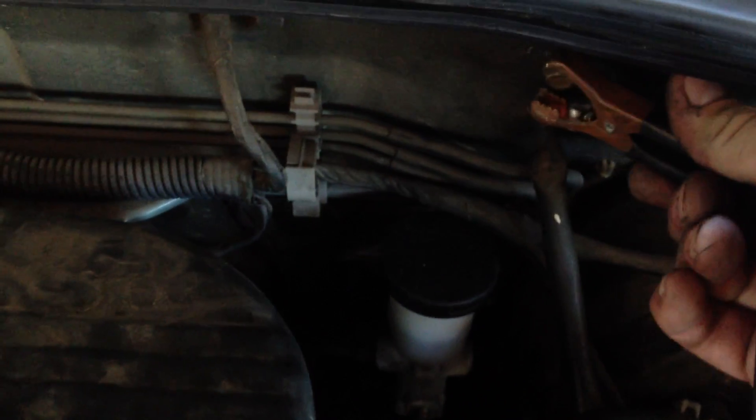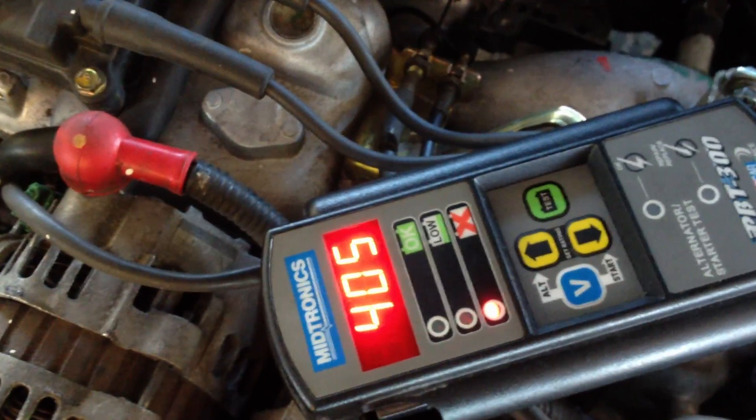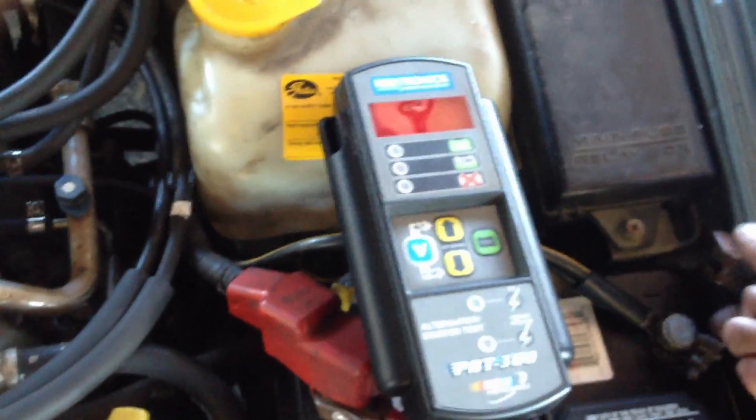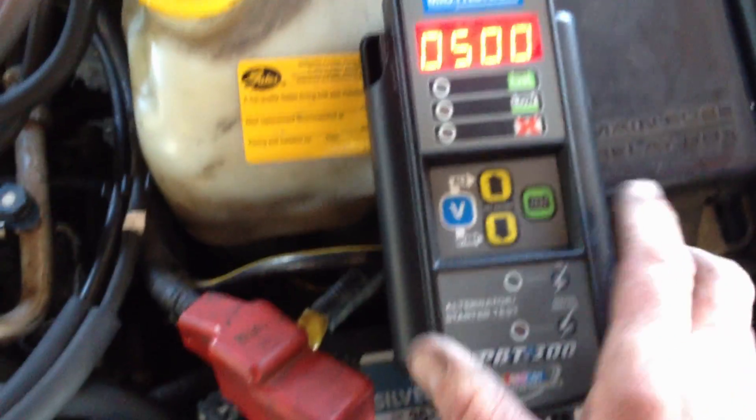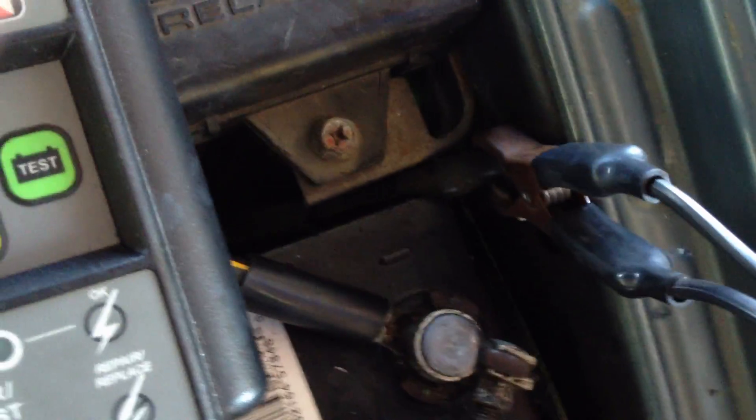This is the one I just put the engine in — this is the 500 dollar car. You can check to the body, same thing. 405, so it's 90 amps between the battery and the body. Now right next to the body and right next to the battery — and I didn't clean any of these, so don't give me a break. Everything's working right though. 335 — that one's a bad ground.